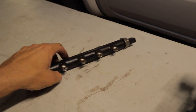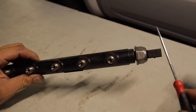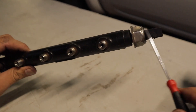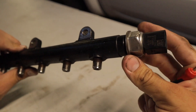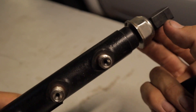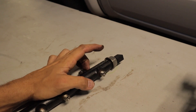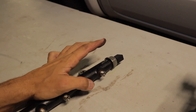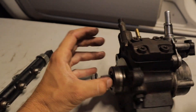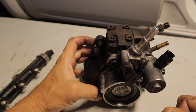The last thing I'm going to be talking about is the rail itself. I have seen that the rail pressure sensor can play up and short out sometimes — pretty easy to replace, I think that's about a 21mm socket on the rail. You just undo it, put your new one in, and plug the connector back in. You will see a pressure sensor fault code come up if this does fail, so they're pretty easy to locate. Similarly, if your regulator fails, you'll see a fuel pressure regulator fault code — pretty easy to diagnose.